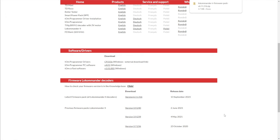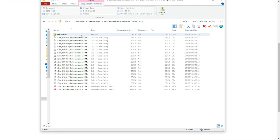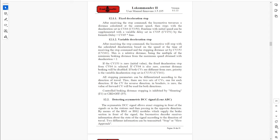First step: find out which version I have. It's 3.5.233 — yay, neither. I tried to configure it like the original documentation and did not get constant distance ABC braking. It did stop, but getting repeated stopping at the same point was difficult, even with identical entry speed. There was clearly no attempt to stop in a constant distance at different entry speeds.